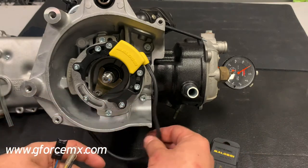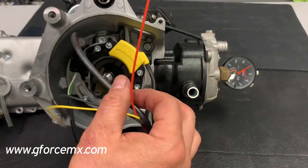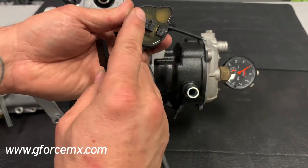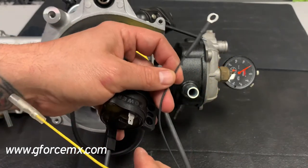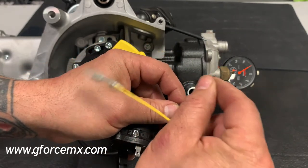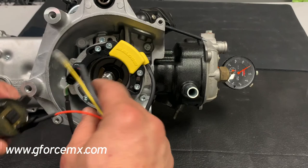You've got a plug coming off your stator that plugs in directly — piece of cake. Then you have your orange wire that goes to the coil, just like on the stock ATV — an orange wire to the coil seems to be a universal thing. On the coil there are two different spades; this requires the bigger spade. You'll also have a black wire, which is the ground — make sure you put it on the frame somewhere it's making metal contact on both sides, not under powder coat. Then you have your yellow wire, which goes to your aftermarket tether. You can also hook another post to an ignition kill tether.